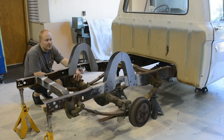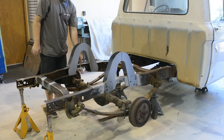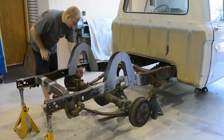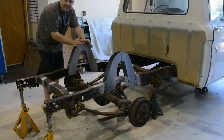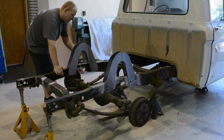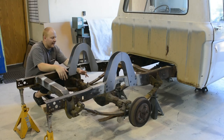The suspension I'm doing right now has about 7/16 from full bump to full droop. At middle height, it's right where it needs to be. When it comes up, it's gonna be about 7/16 of an inch forward in the notch. And then when it comes all the way down, it's gonna be 7/16 forward down here. I moved this notch about 7/16 of an inch forward of my center line, where mid-travel is gonna be. So hopefully when the suspension arcs up into the frame rail, our axle is gonna be really close to being centered up in this notch. I think it's gonna work out really well.